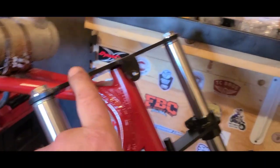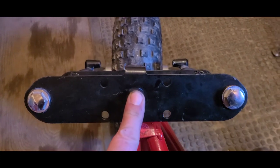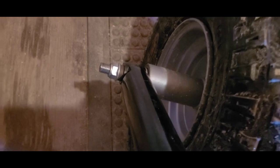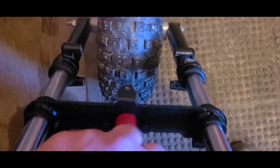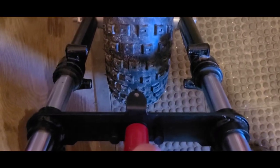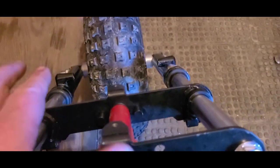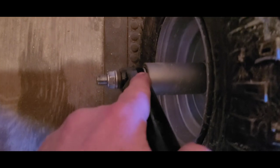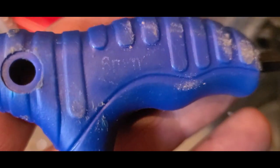I think this rim has a different offset than the ones I've used before with the suspension. Apparently it's just two washers — last time I did this I'm pretty sure I had a couple spacers kind of like those. My axle's on — it's not tight yet but it's holding everything close to square. I'm now going to start at the top and then work my way down tightening my bolts — one, two, three. Once those ones are snug, you can tighten the axle. Put the mini bike on the ground and we're going to push down and make sure that those tubes compress. If it's giving you flack and it doesn't really want to go down, chances are you're out of alignment and you have to add some shims down here on the axle in between the shock tube and the wheel, just like I did with those washers.